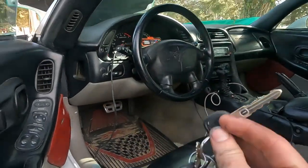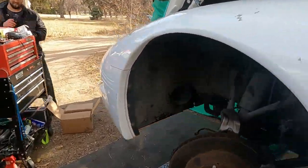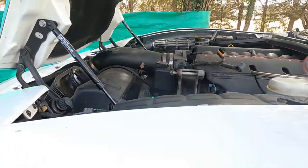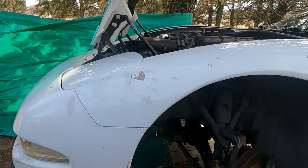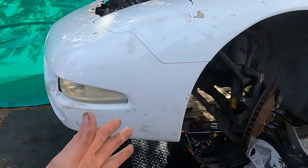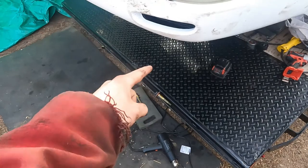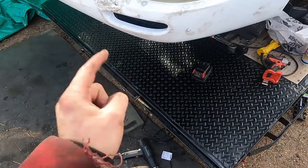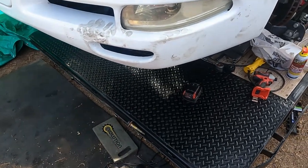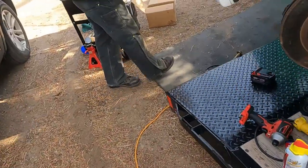Then we came up into the Corvette, took the ignition key, and turned it. Before I turned the key, I unplugged all the spark plugs because I didn't want it to actually turn on and run. That is the way to break loose your harmonic balancer crankshaft bolt. That's been a two-day process of getting this thing out. Now we're out and moving on to the next step — the Chrysler pulley puller.